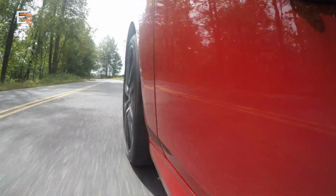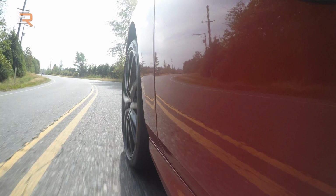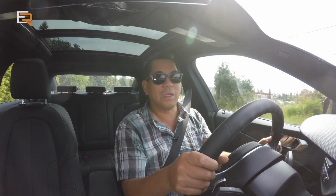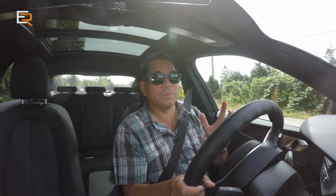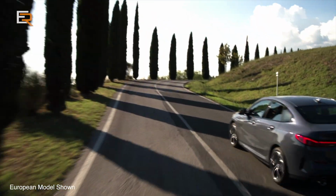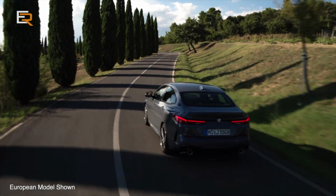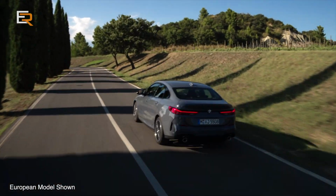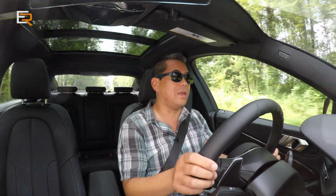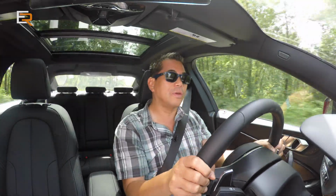So essentially what happens is their slip controller is now connected directly to the engine control unit instead of being connected to the dynamic stability control. And all of that jargon just means that it's a shorter distance for the information, meaning you get a much quicker response. So this vehicle can respond up to 10 times faster for wheel slippage, and that's not just handy for icy or winter conditions. It's also very handy for cornering and accelerating, or both.